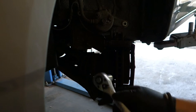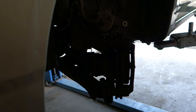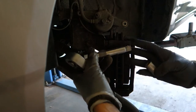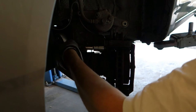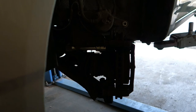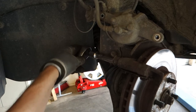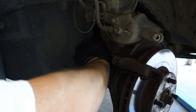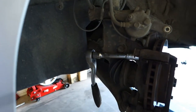And there is a situation that this upper bolt is quite difficult to reach, and it's good if you have this longer joint bar where I connect this bolt in that way, then we can work in here a little bit further out. This is like a hint. And in that way I can open this bolt in that way.